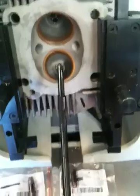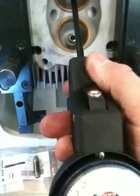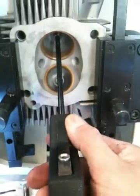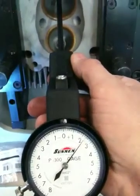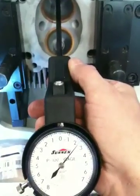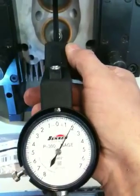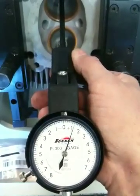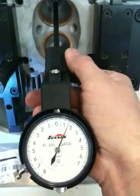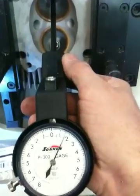So what you can see here is I have a probe — basically a dial gauge specifically for measuring valve stem to guide clearance. Right at the end of the valve I've got a little over 2.0 thousandths clearance, around 2 and 4 tenths, 2 and a half. Towards the middle of the guide it drops down to about a tenth and goes back up again.